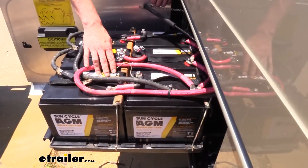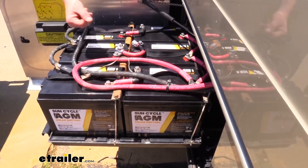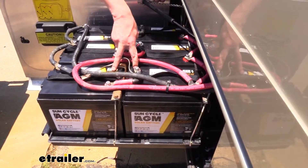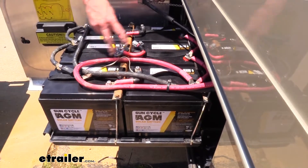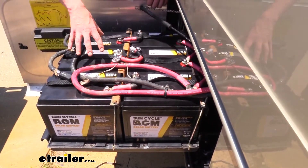These do come as a quantity of one — we're currently installing six today. If you are replacing, I highly recommend that you replace them in pairs of two, so you've got two batteries that are new hooked in series to ensure you've got the maximum capacity. And if you are going to be replacing some banks with some dead batteries, especially if they're very old, I would recommend replacing the entire battery bank.